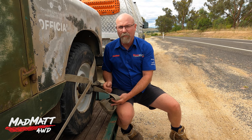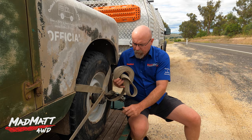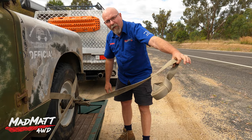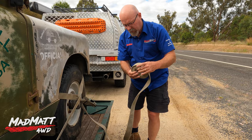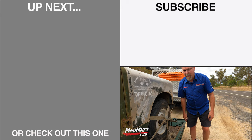And that there is ready to go — keeps your straps nice and tight. When I finish the load and pack these straps up, I will tie them all up like that. On my own car trailer I always carry pretty much the same vehicles, so I have my four straps — two for the front, two for the back — and I can essentially leave them tied up like this at the perfect length. But should I want just a little bit more strap to tie a different car, I can pull off a little bit more, hook it back over, and now I've got more strap available to me. Just curl it up, feed it through, hook it over — job done. Going to hit the road, I'm out of here.